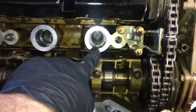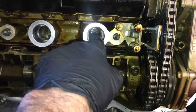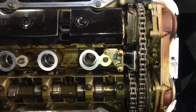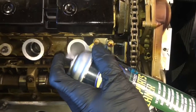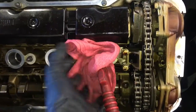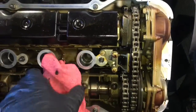When cleaning up the cylinder head, if your valve cover was leaking down the tube seal, the spark plug holes will be full of oil and you'll have to clean that out. I don't recommend taking the spark plugs out and letting all the oil drain into the cylinder head. What I like to do is take a can of Brakleen spray cleaner, spray it in the hole, then take a shop rag and cover it up, use an air blower and stick it in there. Blow it and catch all the debris in the rag as it blows out. You might have to do that a couple of times to clean it out.